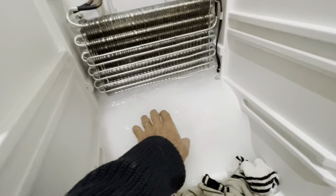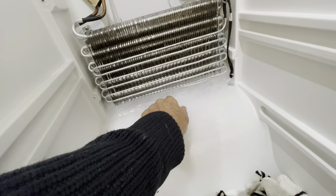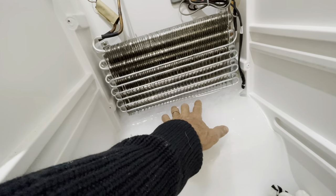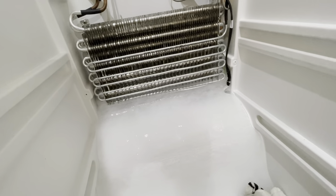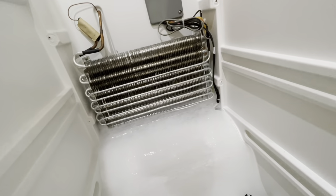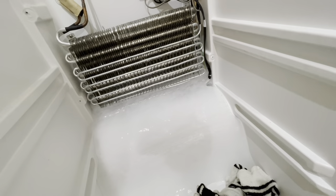What's the reason for all this ice? Without the ice being there, you'll see there's a little drain hole at the back. As air condenses on the pipework, water drips down to the bottom, goes through that little hole, and collects in a tray on top of the condenser — the heat from the condenser then evaporates the water. That's how it keeps frost-free. Once that hole and mechanism gets blocked, water starts collecting, turns to ice, and just grows and grows as you can see.